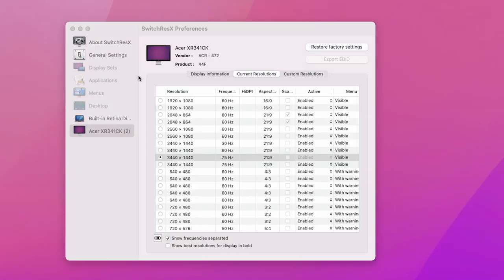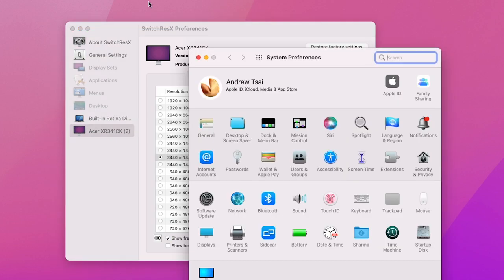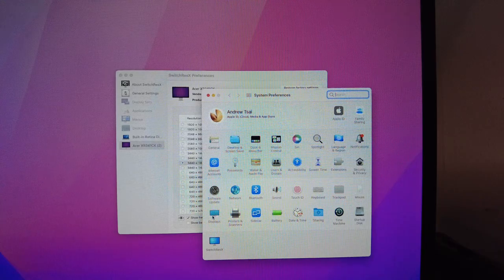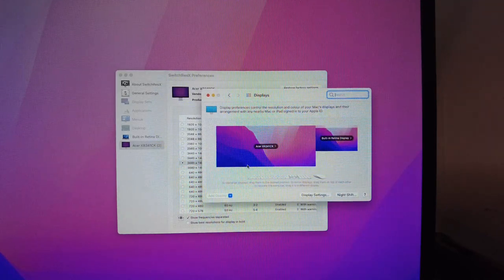So one initial thing to note is that when I first connected the monitor to the Mac, the actual refresh rate and monitor resolution weren't set correctly and couldn't be set in the settings menu. I had to use an application called SwitchResX, which I'll leave a link to in the description. It is only when this has been set correctly that you can actually see the Adaptive Sync menu item displayed properly.